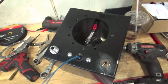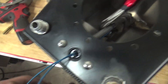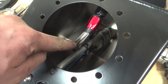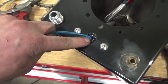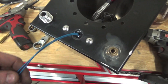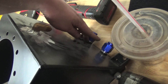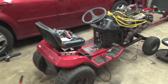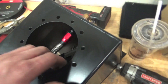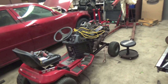Before I button this guy up, I'll show you guys what it looks like on the inside. We've got our fuel pump down there, our wiring for the fuel pump, and our feed from our pump that comes out right here at a 90. We'll JB weld this so it doesn't leak. There's our return — our 6AN return and our 10AN vent — and we've got two 10ANs just capped off down there. This will go right in the middle of the mower. We're going to get this installed and show you guys how to plumb in a fuel pressure regulator and set our pressures correctly, then fire this beast up.